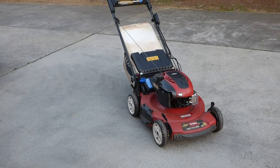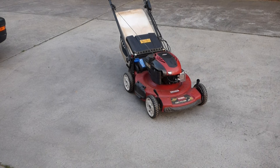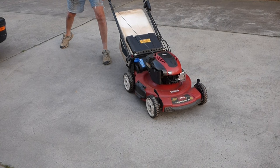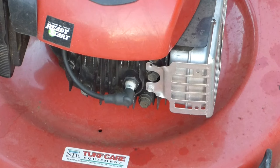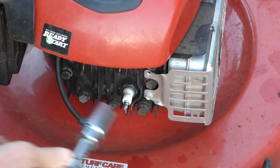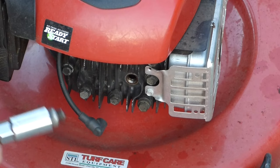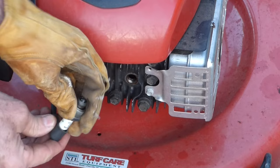She's been running about 10 to 15 minutes again. I'll shut her down, see if it won't start, and then we'll check for spark. No start again. You want to be careful when you're pulling these out hot — you don't want to burn yourself. She's hot.